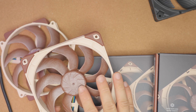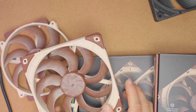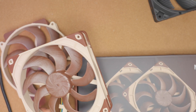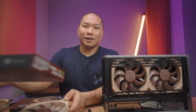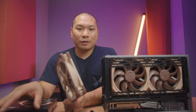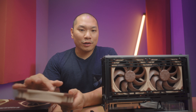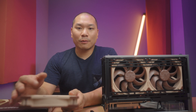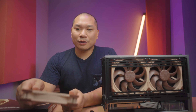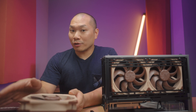One additional feature is that these will stop completely when a 0% PWM signal is present, versus running at a minimum RPM like some older fans. They're also doing what they call a push-pull kit — essentially a two-pack of the square G2 fans. The two fans are guaranteed to be offset by roughly 25 RPM to avoid running at the same speed, which could cause harmonic resonance or a beat-type frequency noise in a push-pull scenario such as on a heat sink.